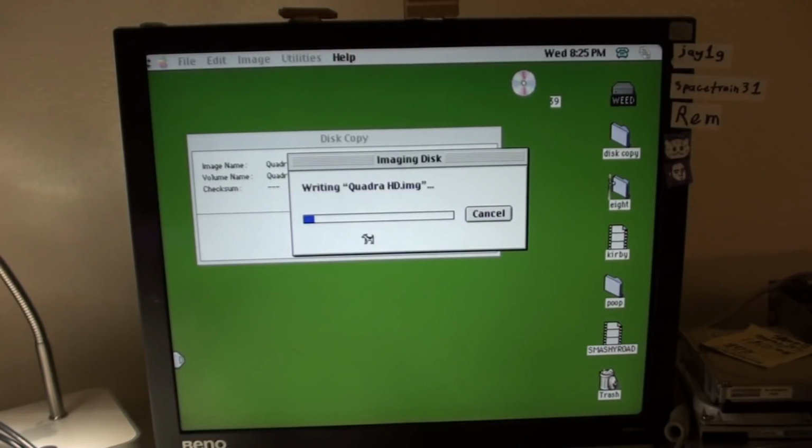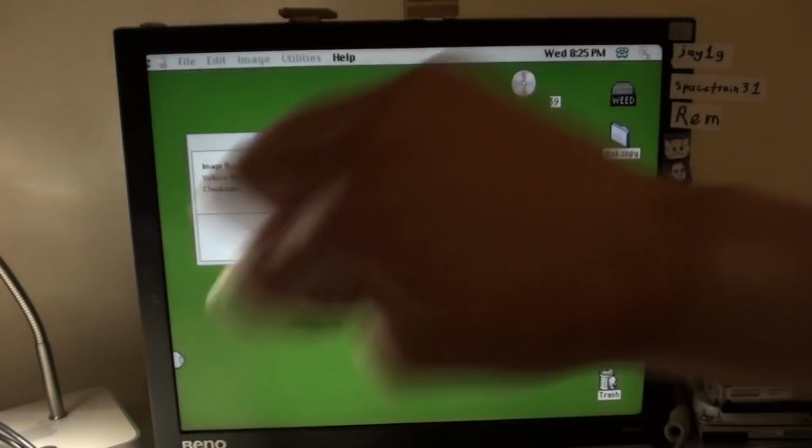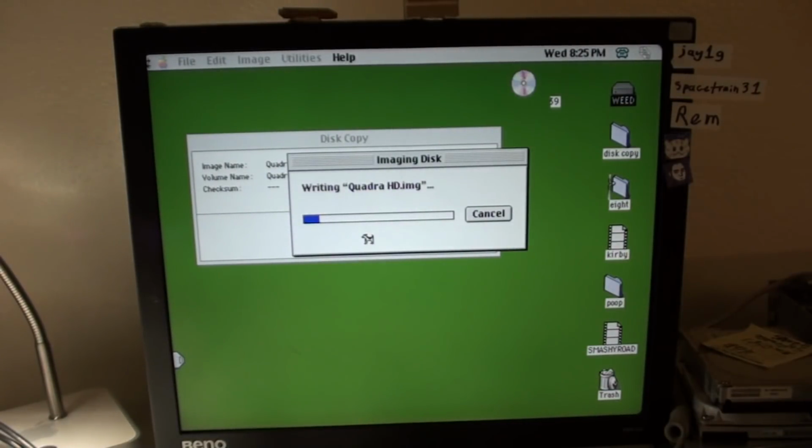It's really just a container for a directory of files. Because of the nature of old Macs, the only thing they need to boot is a hard drive filled with the system folder and some files in it that make up the functioning system. You don't need any weird boot record stuff. You don't really need a bootloader or anything like that. The logic board just finds the system folder, and you of course need to have the drive in the right format as well, but it just finds it. So you can drag and drop an entire system over to a blank drive, and that drive is now bootable. I wish it were that simple in modern times, but no.